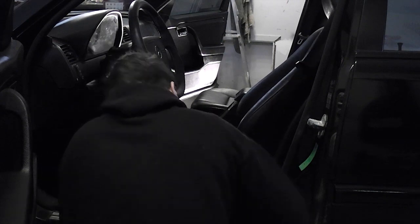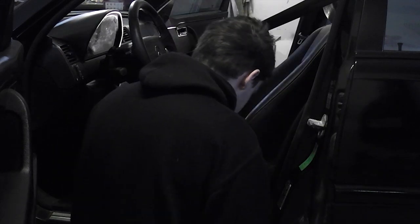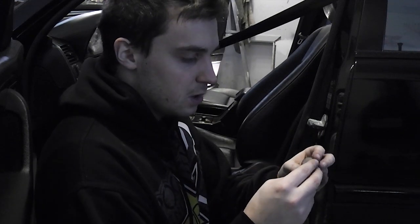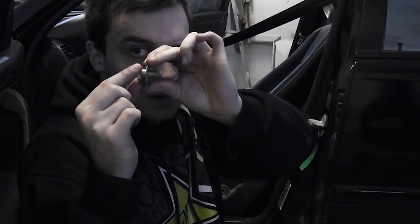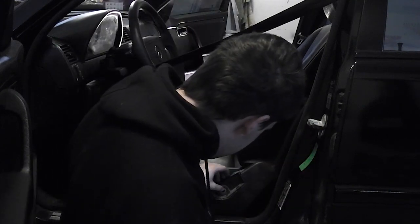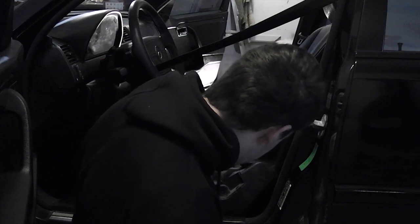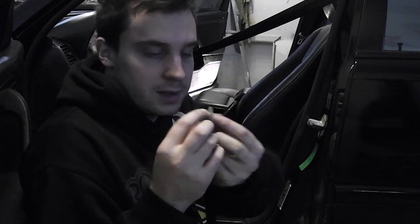You've got to unscrew the seat belt too. The washer is actually between the seat belt buckle and the bolt — it doesn't go all the way through, which is pretty cool. So you can't over-tighten it, and it still lets the seat belt pivot. The sequence is: small washer, big washer, seat belt, bolt.